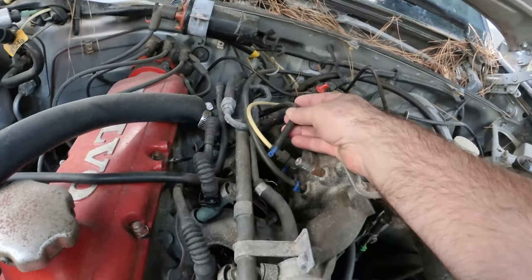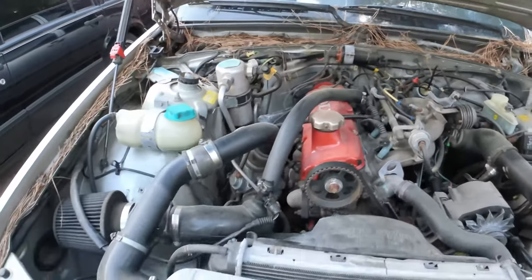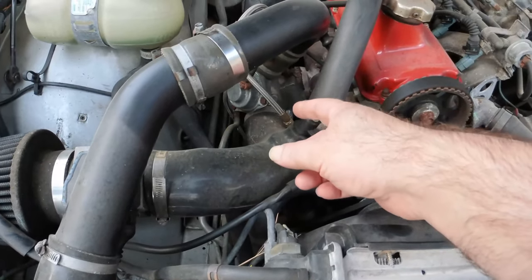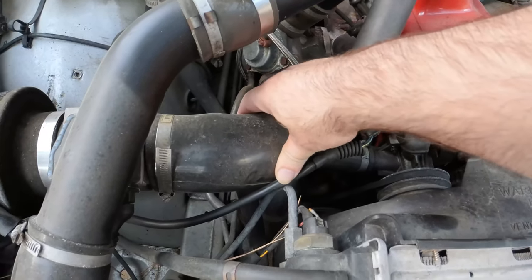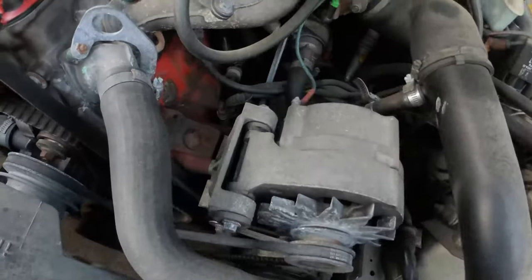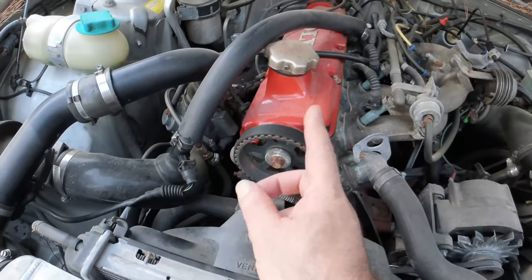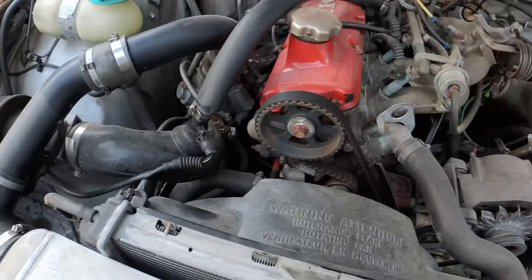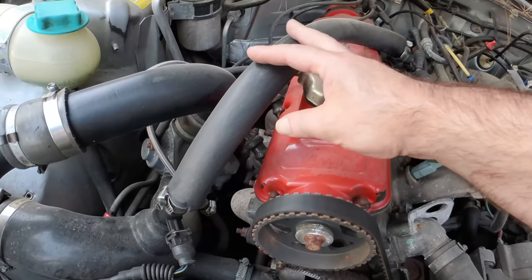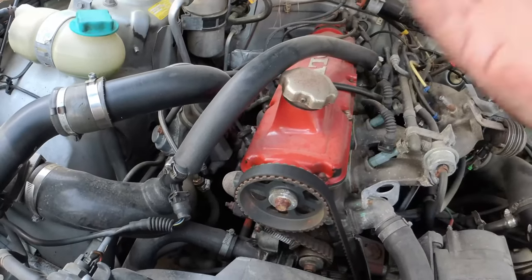There's supposed to be a check valve on this, and I see that there's not — that needs to be fixed. This is the suction part of the turbo right here, and once it hits boost, it has a lot of suction — enough to collapse this hose if you don't have it reinforced. That's where it pulls vacuum from the crankcase. A good place to pull vacuum from is right here. Bad places to do it are up here on the valve cover — why? Because the camshaft is spinning and slinging oil; you don't want oil getting into your turbo. A lot of people put catch cans because they put a valve cover vent up there, it starts slinging oil, and the turbo starts ejecting oil — so then they add a catch can and go on with the backwards mods.